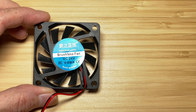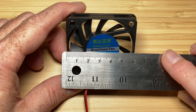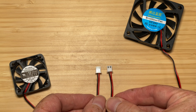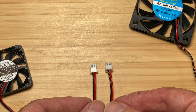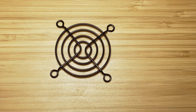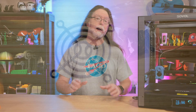This is a 24V 6010 fan, which will replace the stock 24V 4010 fan. Those numbers mean it's a 60mm diameter fan, and it's 10mm thick. Fortunately, this fan's connector is wired exactly the same as the stock one. On other printers when replacing fans, I usually have to swap the position of the black and red wires, but this one was already set up correctly. And here's the fan grill, also sourced from Amazon. I picked up this particular one because it also included the screws, which are designed to go right into the fan's screw holes — so I don't need to source screws and nuts and washers.